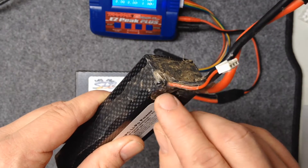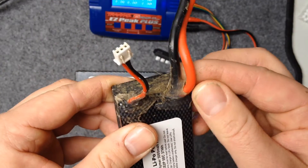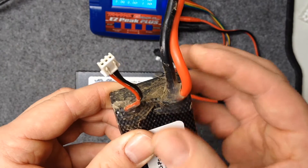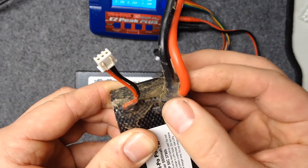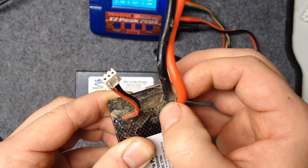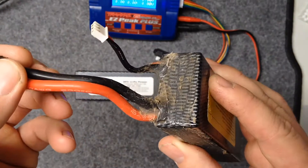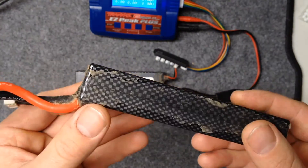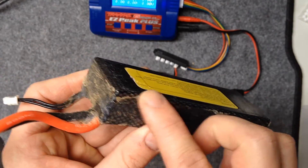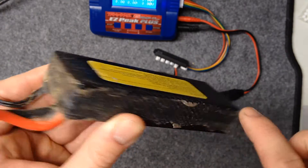Then of course up and around the terminals where they go in — it's a little bit larger opening, especially this one — and I use silicone sealant on there also. I make sure when I put it on that I squeeze it in there to get it down a little further between the wires and all that, and then around the outside. This stuff is super flexible and super adhesive so it's not going to come off. It's only sealing the actual seam.